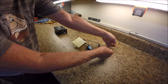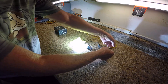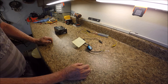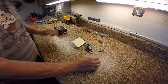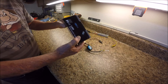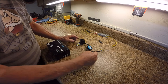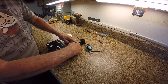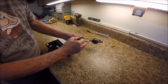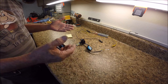Now we're going to hook up the high beam. Look at that — much brighter. That's how you can check the LEDs out and verify the wiring. Always look at the package for instructions. On low beam, only two of these four sides light up, and when you have the high beam on, all four of them light up.